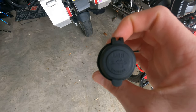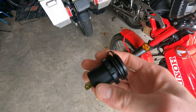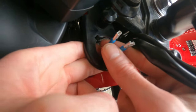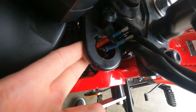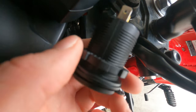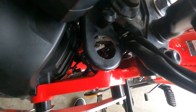I'm not going to put a fuse in this time — I'm going to do that later at a different date. I'll have to go buy some wiring and electrical stuff. Now I have the old USB outlet out. You can see the two wires here — I have them heat-shrinked with waterproof heat-shrink. I did mark which one the positive is, just anticipating that in the future I'd have to replace that USB outlet. Because they are pretty cheap — $10 on Amazon. Basically, I'm just going to take the new one, plug it right in, and that's really going to be the bulk of this whole thing. I'm going to be able to reuse this threaded lock ring from the old one, slide it into place, and then lock it down after I get the wires connected.